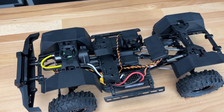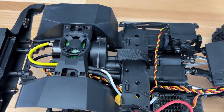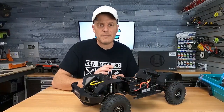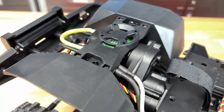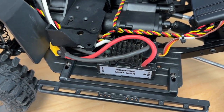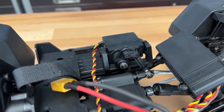First up, the battery tray here. The battery sits towards the front, and you could adjust the battery tray for shorty packs or standard style packs. I did go with a Holmes Hobby power system in here. I have one of his 540 Trailmaster motors, BRXL speed controller. For servos, I went with Hi-Tech. I have their 645 MG for the shift servo.